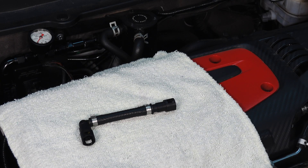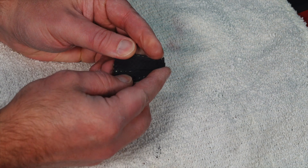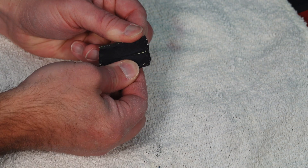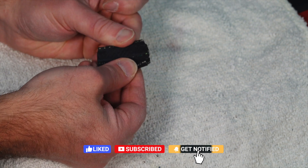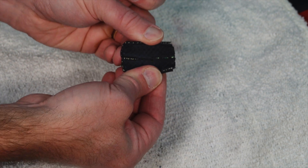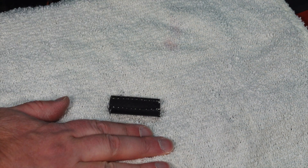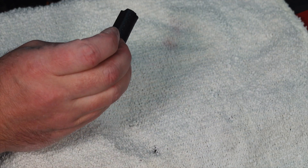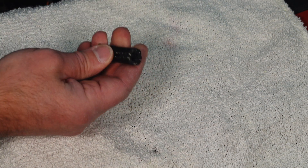Now let's see if there's any deterioration in the existing hose. It looks pretty good to me — I don't see any signs of deterioration. That looks really clean, so that makes me feel better. However, I feel a lot more confident having the new hose in here. Maybe this just hasn't deteriorated because I haven't given it enough time. Regardless, I highly advise: if you're not going to get one of these, get a replacement PTFE hose appropriate for ethanol blend so it does not break down.